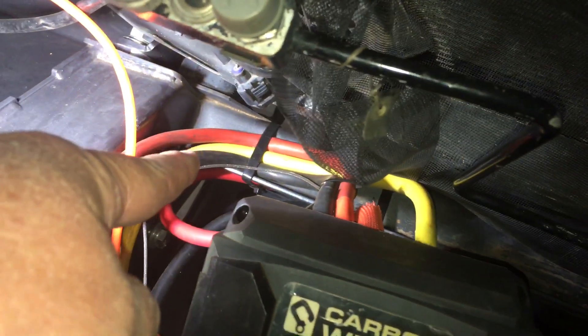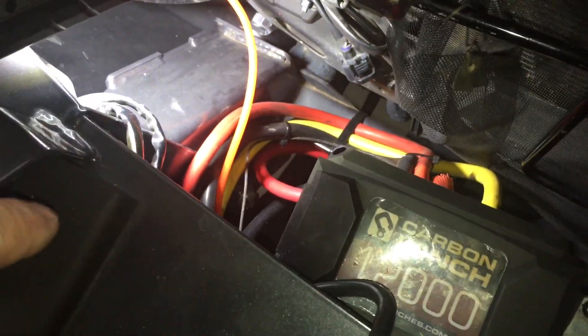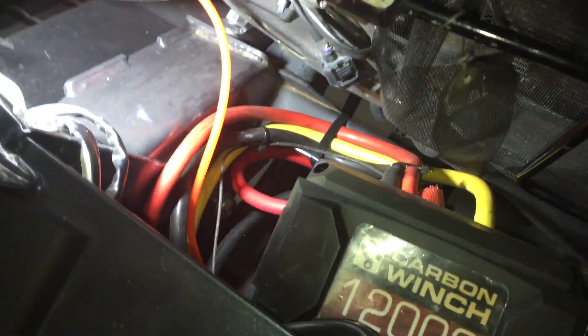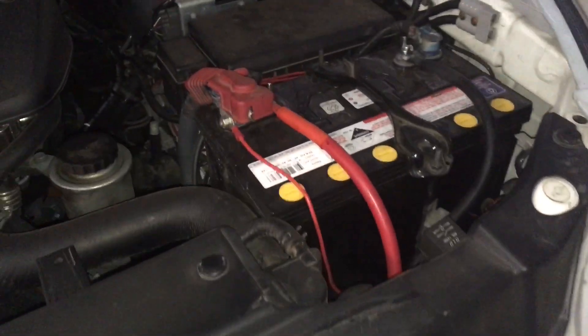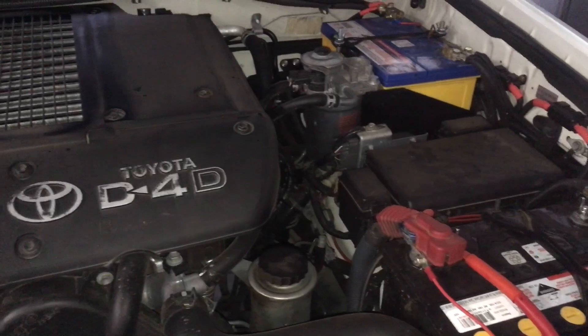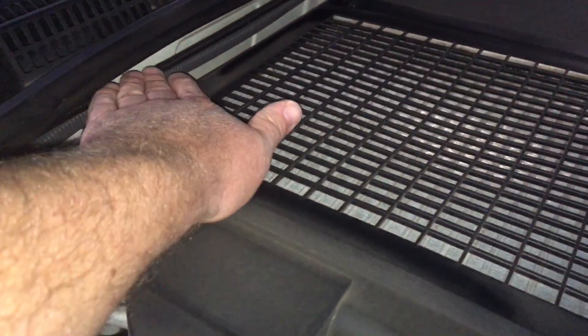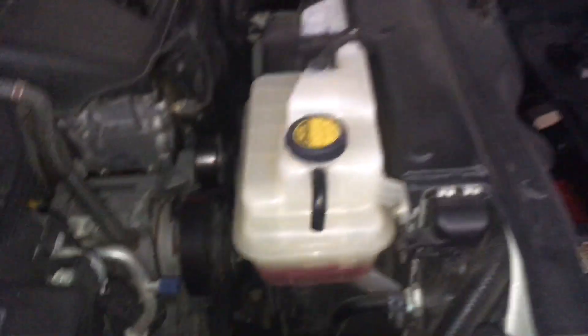Use a bit more than just a short section - fill the whole length. I don't care about the black negative wire because the bull bar and everything is already earthed. But if you put the positive of the battery to the bull bar it's going to arc up. It's the red and yellow wires that need corrugated split tubing all the way. You're going to have to redo that and disconnect all your batteries while you do it. After watching this video everybody needs to rethink their auto electrical - it's just not worth the risk.